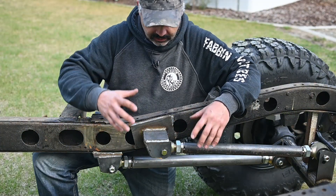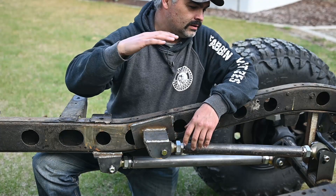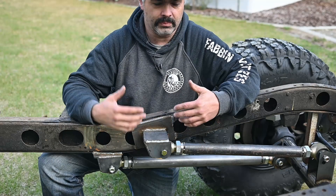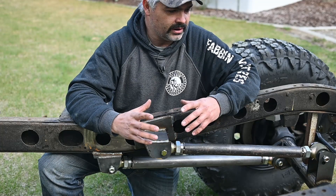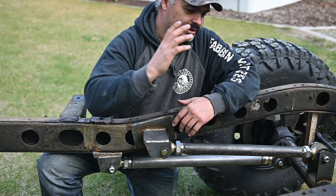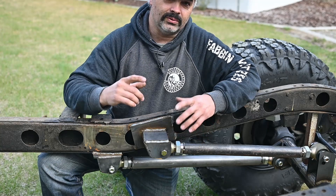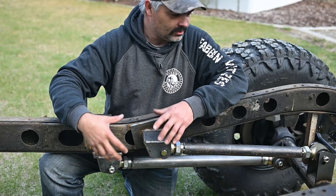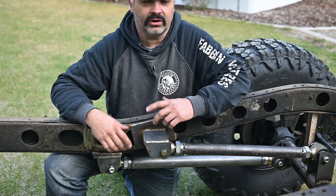What we're looking at here is the upper and lower link of the three-link. I opted to do 70% of the length of the lower links — that way, as your suspension travels through its cycle, it keeps the diff basically level. This FJ we planned right from the beginning to be able to drive down the highway lots. To get the proper suspension geometry for both wheeling and highway — there's no perfect one. So I opted for this way. It's going to be great handling on the highway, but when you really make it flex, it's going to be harder on your U-joints. That's just a trade-off you're going to have to make. With the TMR kit, the lower and upper buckets were a one-piece unit, which would have kept your links at equal length — perfect for wheeling, where your diff points up to your transfer case all the time. That's easy on U-joints, good flex, and whatnot.